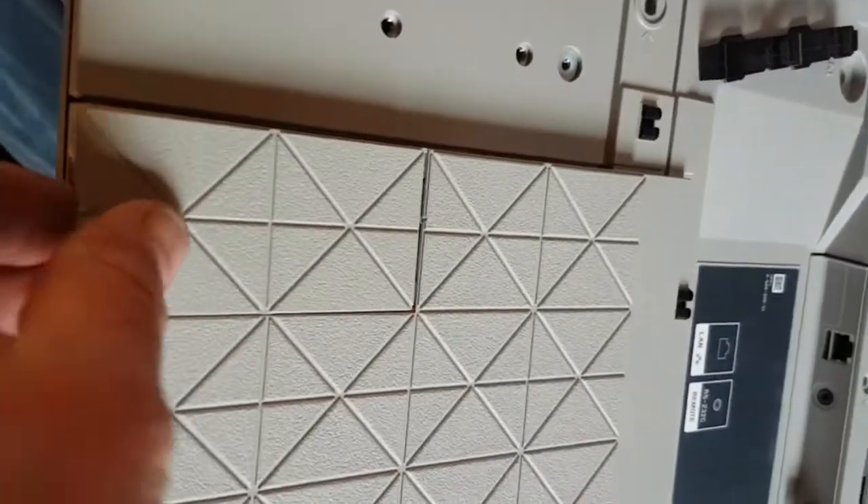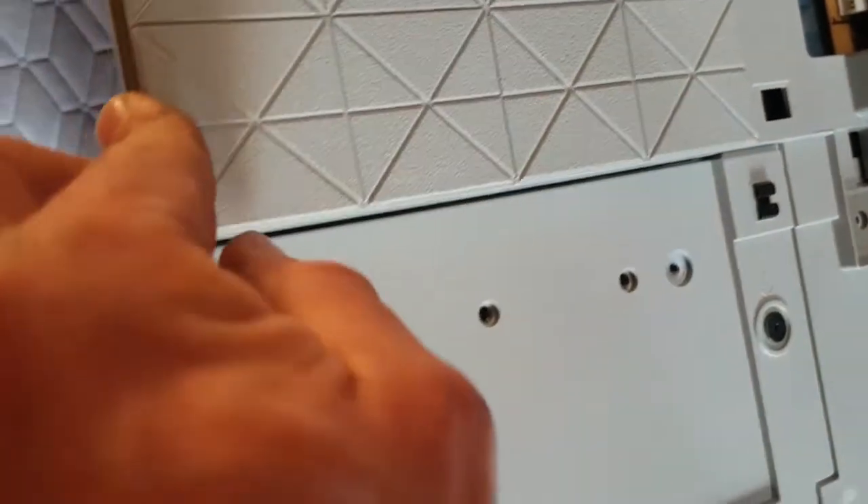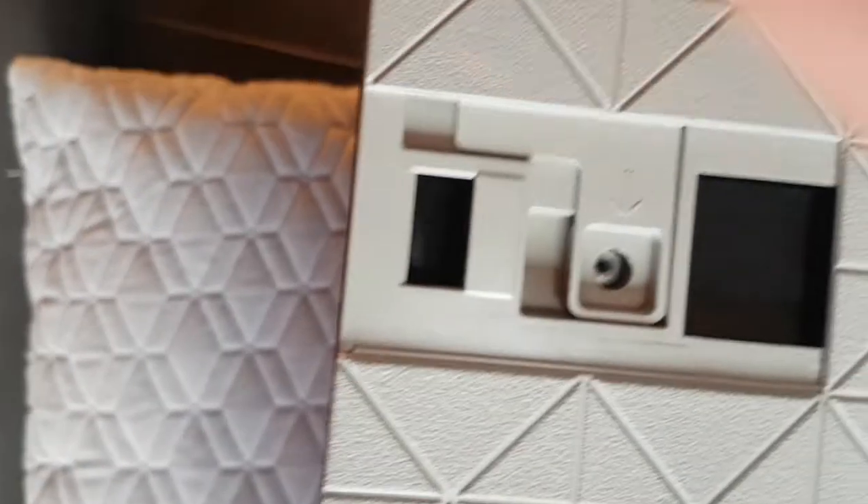Normally the tuner would be mounted on the main circuit board and you'd be looking at two or three hundred dollars for a whole main board if you couldn't fix the socket. It's not impossible to solder it, but you'd have to do the same disassembly work anyway. Another option is to cut the female end off a coax video lead and solder it back to the circuit board — but thankfully they do make it easy to just replace the module.